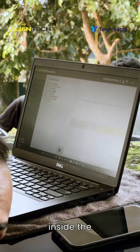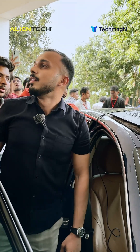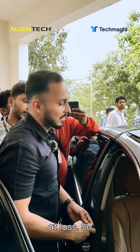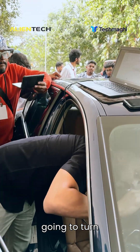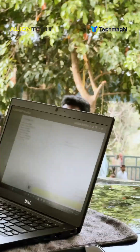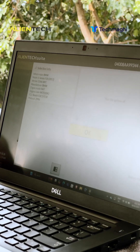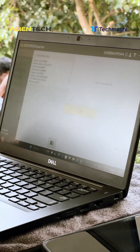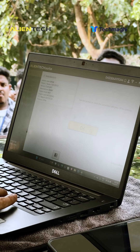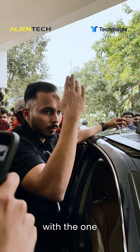Since it's a start-stop car the key fob has to be inside. I've got the key and kept it inside. I'm going to turn the ignition on — the ignition is on. The Alien Tech device now checks and starts communication. As you can see it is identifying the ECU. The next procedure is to turn the ignition off and then turn it on again. Depending on the car this can happen five or six times. ECU successfully identified — it has matched this ECU with the one on the server and now we can get the reading.